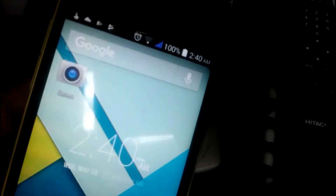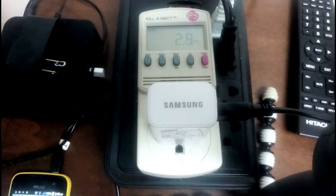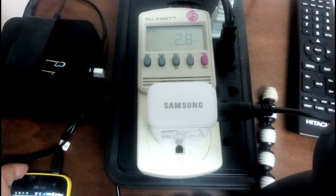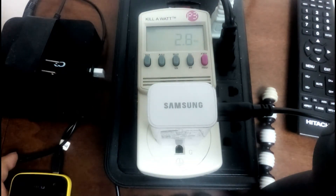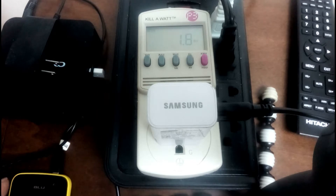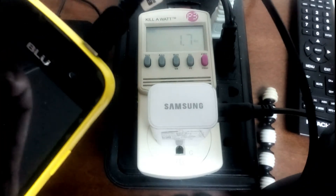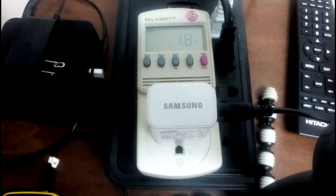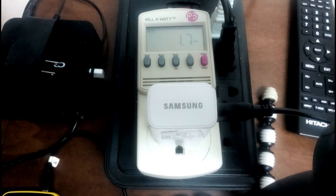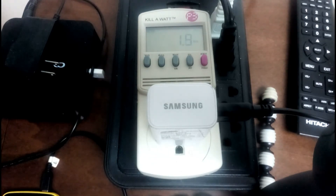We're back — the phone is at 100% charged. With the screen on, it went down to 3.1 watts. Once the screen turns on it uses more than a watt of power. If the screen is off, since it's already charged, it drops by about 1 watt. Switching off the screen drops it another watt. So once connected and fully charged, the phone still draws about 1.9 to 2.0 watts from the USB port. In the grand scheme of things that's low, but if you have four or five phones it adds up.